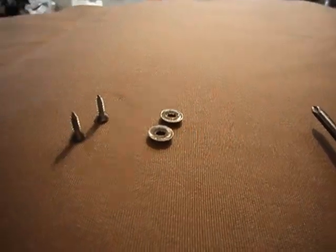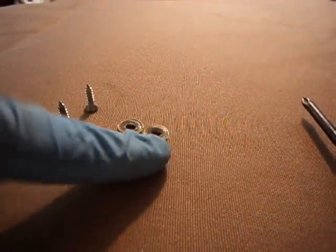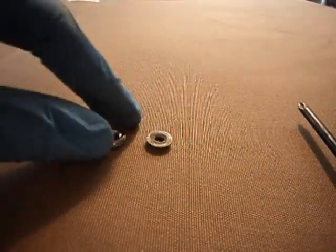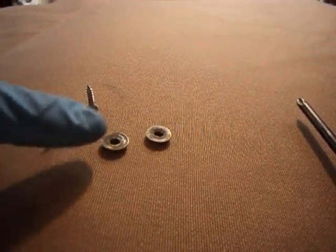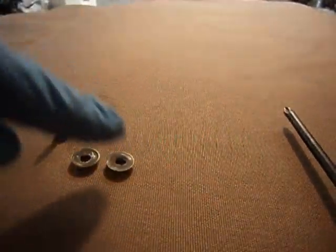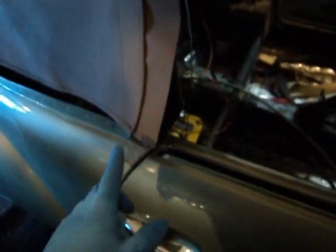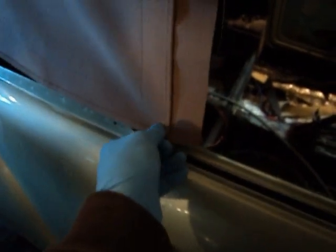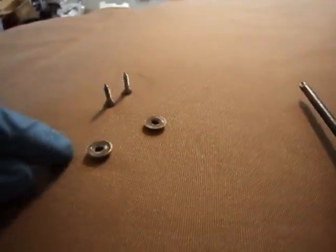Just to remind you from my last video on the convertible top — you really can't get closed-back finished washers anymore. What I did was take some stainless steel finish washers, use some heat shrink through the center hole, and fill them with epoxy, letting them dry so the back is relatively smooth. That way they don't dig into the top around the edge — they have a smooth surface to bear on. The next operation: we're going to poke a hole through here and attach the top at the factory mounting point. Scary — you have to put a hole in your brand new top.